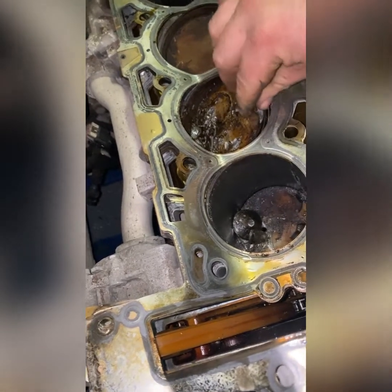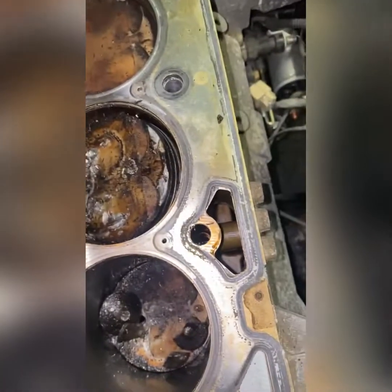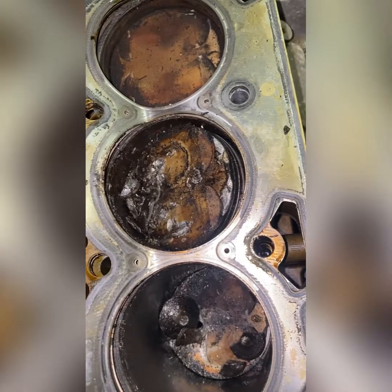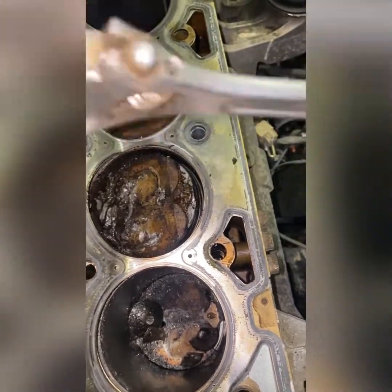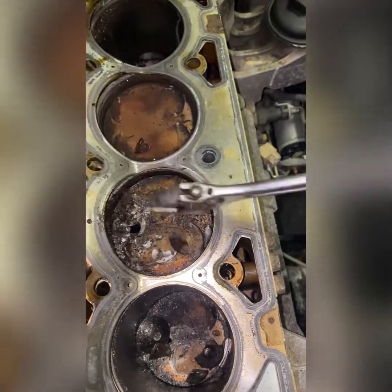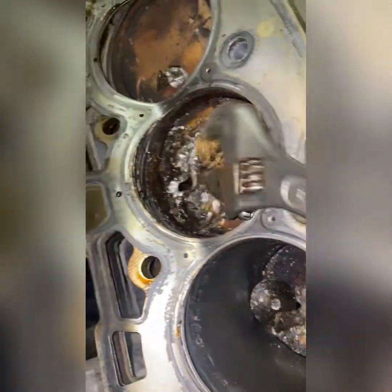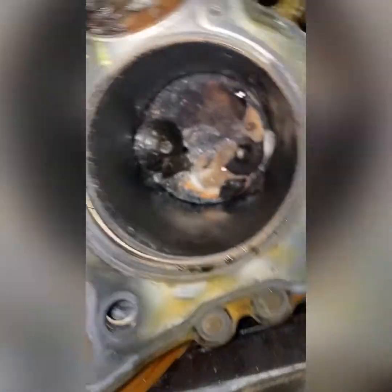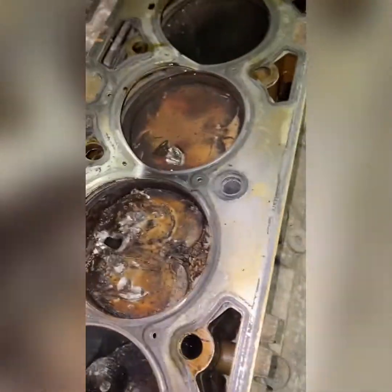I am just so impressed that it had been going fast, broke number two rod and spun the piston inside the damn cylinder. Holy bajolies, man. Talk about impressive. Now, if these cylinders weren't busted here and here and all the other damage, the engine was pretty well taken care of. Well, that cylinder's busted too. Look at it back there. Oh man, Justin's here. We're going to get his reaction. I'll see y'all on the update.